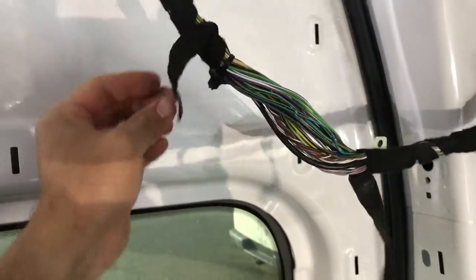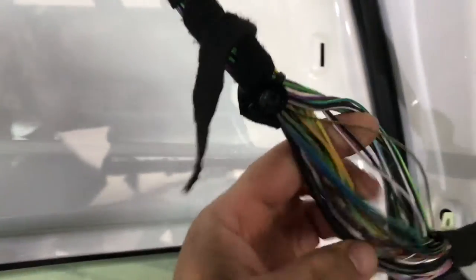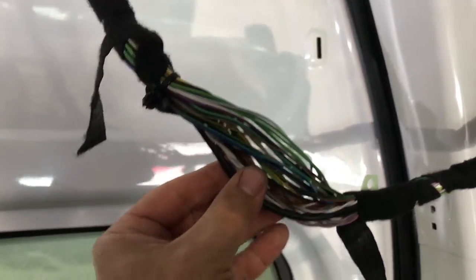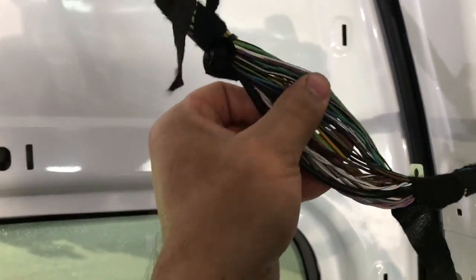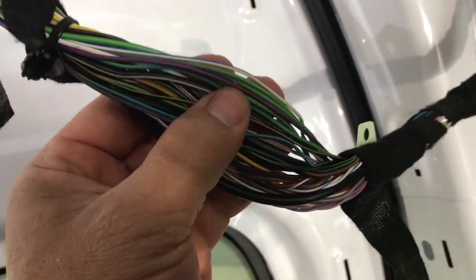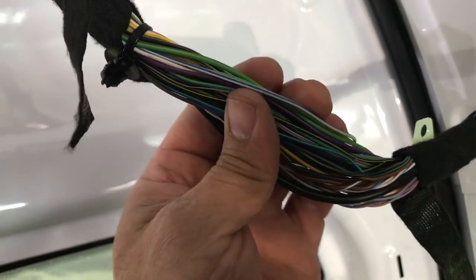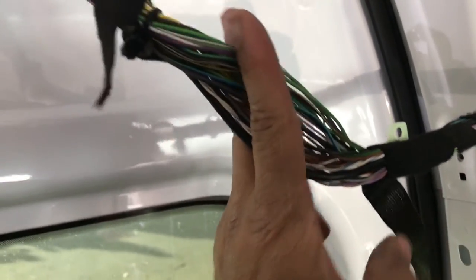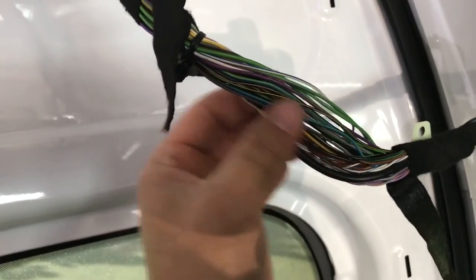Here's the splice — the ideal way of cutting these. I've done this before on my Jeep. They're all different colors; the green one has quite a few duplicates, so you may want to write down the colors and where they go, or take a lot of photos. I've been doing wiring for quite a long time so I do pretty good. If you cut straight you end up with a big ball of solder and heat shrink.